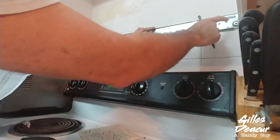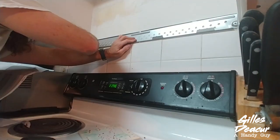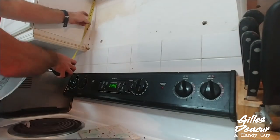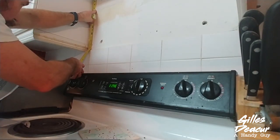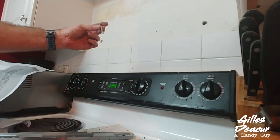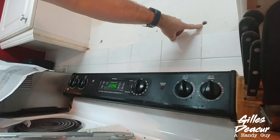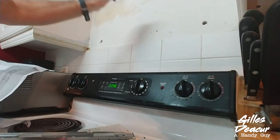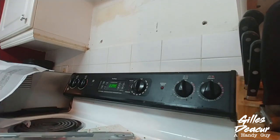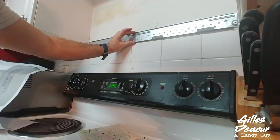I think we're going to do it right here — we've got an even amount of space between this end and that end, and everything is at about the same height. Circle that hole, circle that hole, circle this hole. I'm going to double-check the height to make sure nothing is crooked. From here to here is 15 and 3/16ths; from here to here is 15 and 1/8th — close enough. When I was uninstalling the last one, I noticed this screw was more than likely in an actual stud. The other ones were for hollow wall. I'm going to try to put my new microwave into a stud as well, and use toggle bolts for the hollow drywall areas.